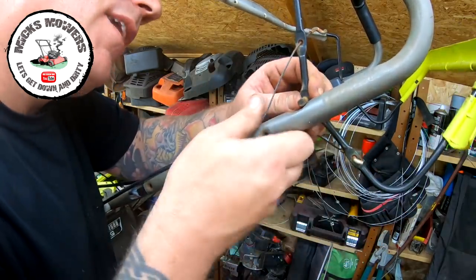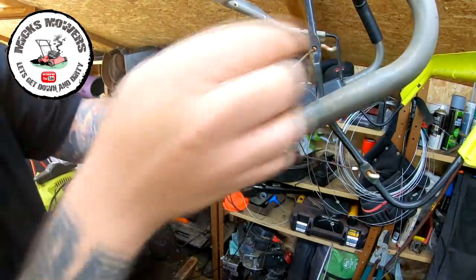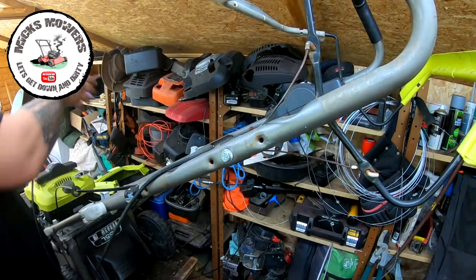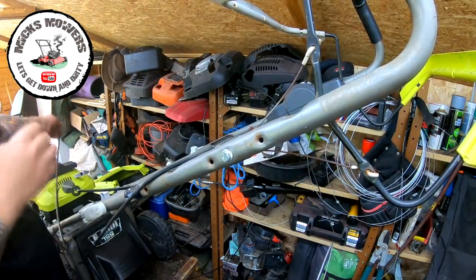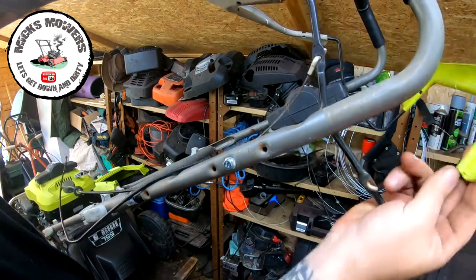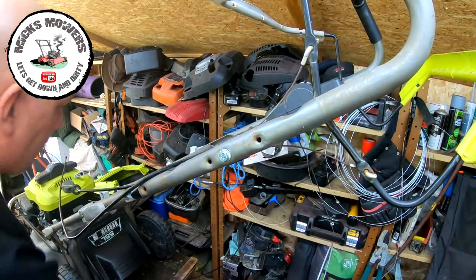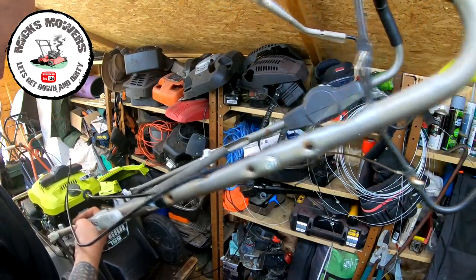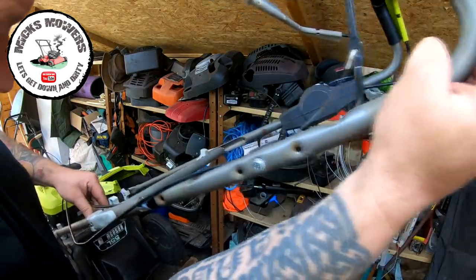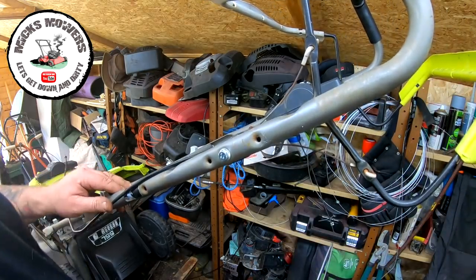Goes into there, and then that one then goes up onto there. Oh, that's gone all the way around. That's because it's not connected to the other end. You pull that cable out a touch just to take the slack off it. So that's a dead man and the drive, and the drive now works. Let's just test it on the machine, try and pull the machine backwards so it rolls on its own with no drive, and then connect the drive and it locks. So that's working, so super happy with that.